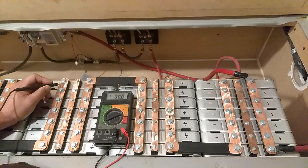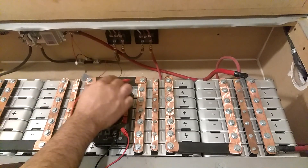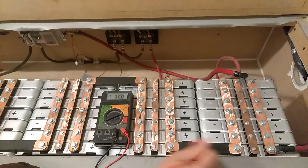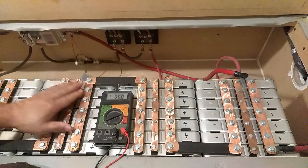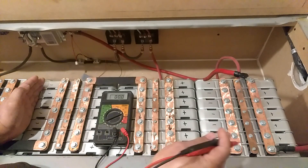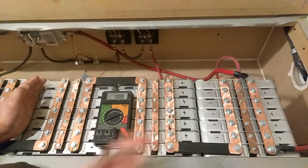So that's how you do it. Every time you run one of these bars over to the next one it raises your voltage. When you run it over here it raises your voltage. Basically that's how you do the 24 volt system on the Nissan Leaf battery. This right here — this is 24 volts from here over to there. These three stacks here are 24 volts.